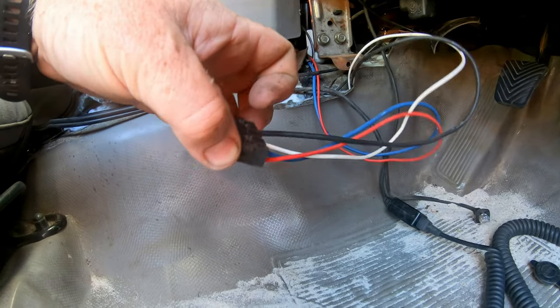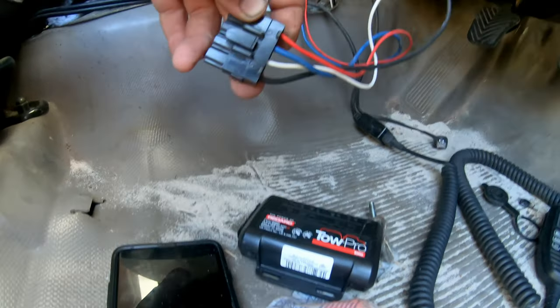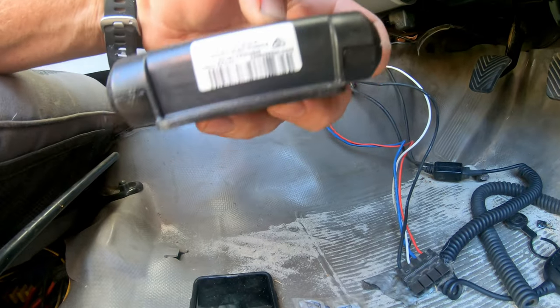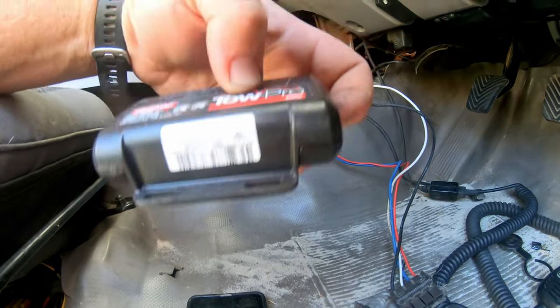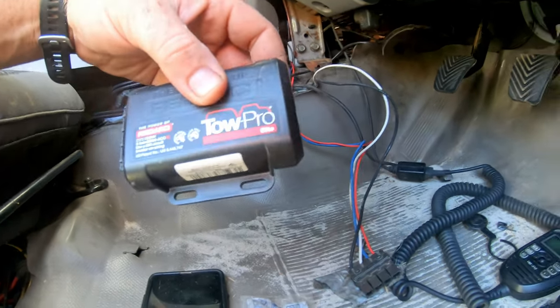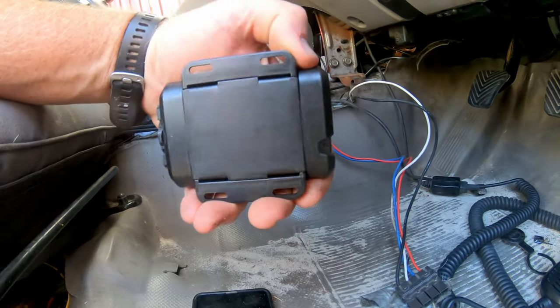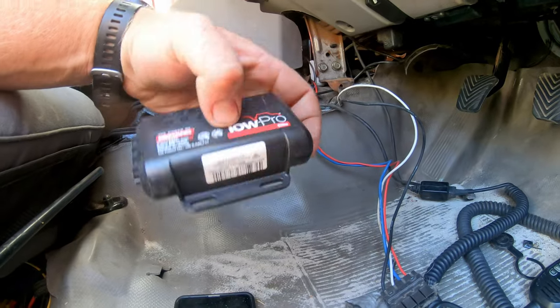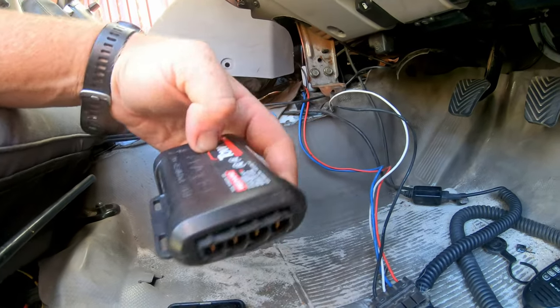Super simple — four wires and then you're ready to plug it in. But first you've got to find a spot to mount it underneath here with all the other fun stuff. Take the time to mount it firmly, because obviously if this is sensing inertia and you're hitting a bump and it's bouncing, that's inertia in another direction. You'll start getting artificial brake input and the brake will start coming on when you don't want it to — every bump will start braking the trailer. So it's important to mount this somewhere solid. It doesn't matter what angle it's on, as long as it's solid. Key point.